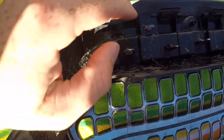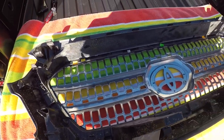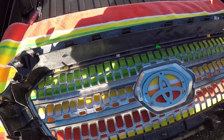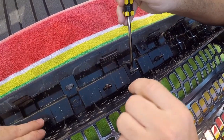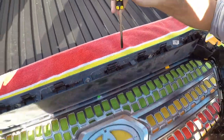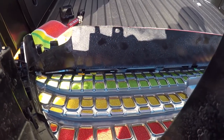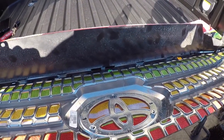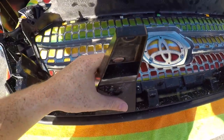The silver tabs right here — just pop this silver bumper off. Obviously put a towel down or something so you don't scratch it up, even though you are putting a new one on, you could potentially resell this. Once you have all the screws out, you're going to start hitting down these chrome tabs. The easiest way to see which ones it is, is just lift up your grille and you can kind of see which chrome tabs go out as opposed to the black that's going to stay on the grille.